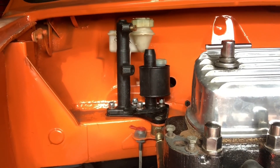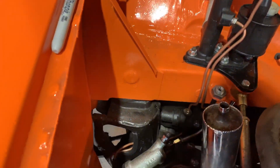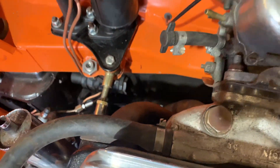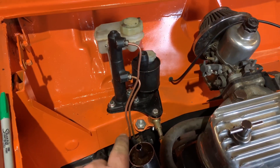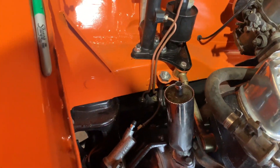Let me just take you to the front of the car to show you where I'm getting at with that. I've got the brake and clutch master sitting there, I've just got to pipe them up to that little valve down the bottom there - so two brake pipes, and that bit will be done. Let me put some flares on the end of these, use this bit of pipe, cut it to size and fit it on. There you go, some brake pipes on. And there's a carburetor there now as well, and an exhaust manifold. I've been cracking on. I've actually been to the parts place as well - the clevis pins that go on the bottom of the brake and clutch master, I haven't got them, so I've just been out and ordered some from a local parts place.